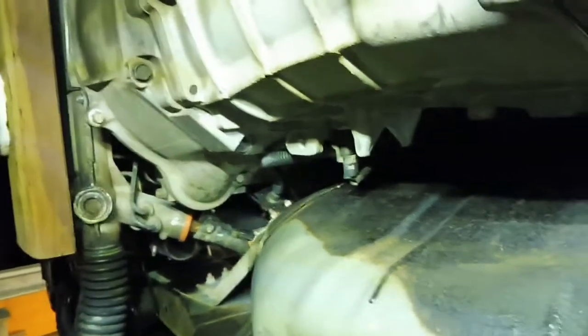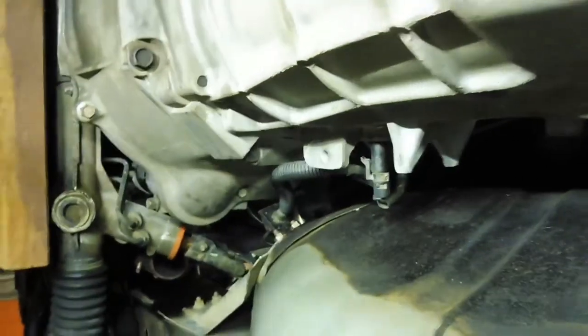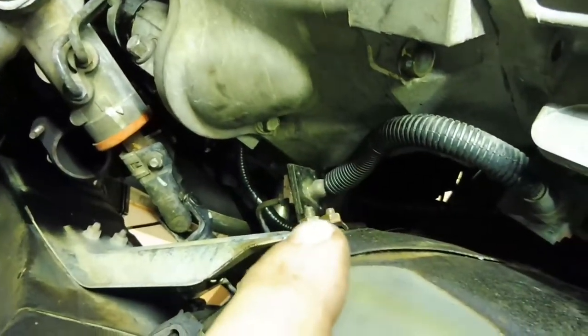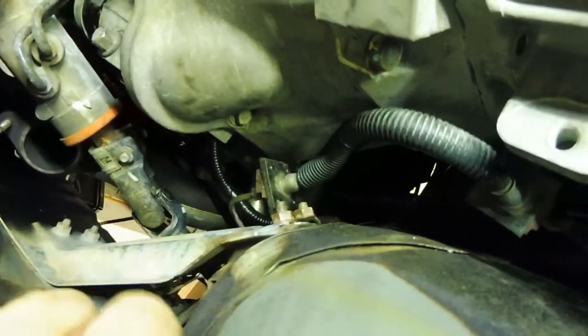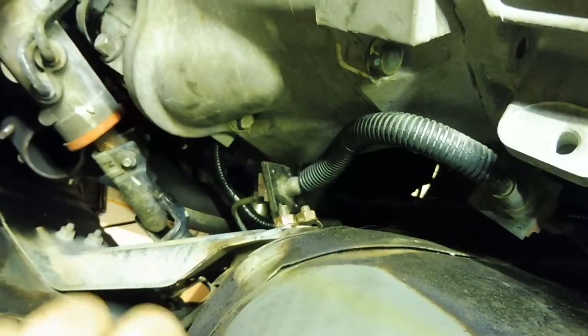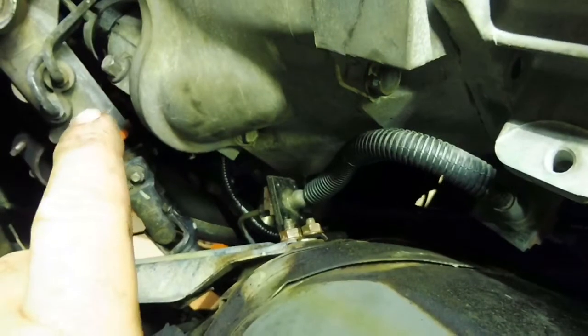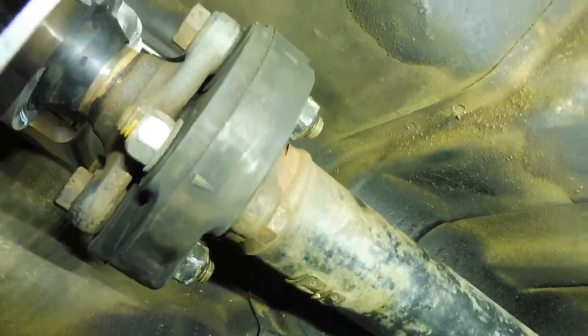Back under the car, this is the bottom of the gearbox, so you know where we are, and you can see the gearbox clutch line and the mount that goes to the side of that brace, and the hard line that goes up to the master cylinder for the clutch. So that's all buttoned up now. I have thrown an oil filter pre-filled with oil up in there, getting ready to start it. Moving back, got the donut bolted on to the front of the tail shaft.